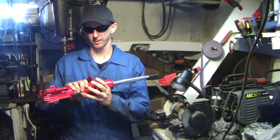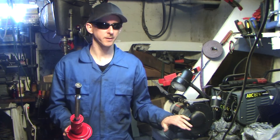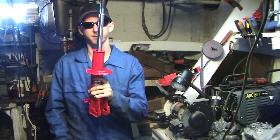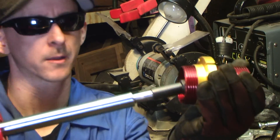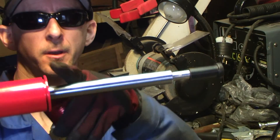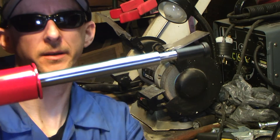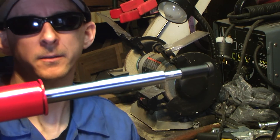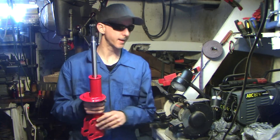Got my Special D strut. I'm going to use a grinder here to grind down the little lip and make it as smooth as possible. Just as one more visual test — this is not fitting over, we're going to have to shave this lip down even with the body. We're going to grind it without compromising the integrity of the strut. So let's go ahead and do that.